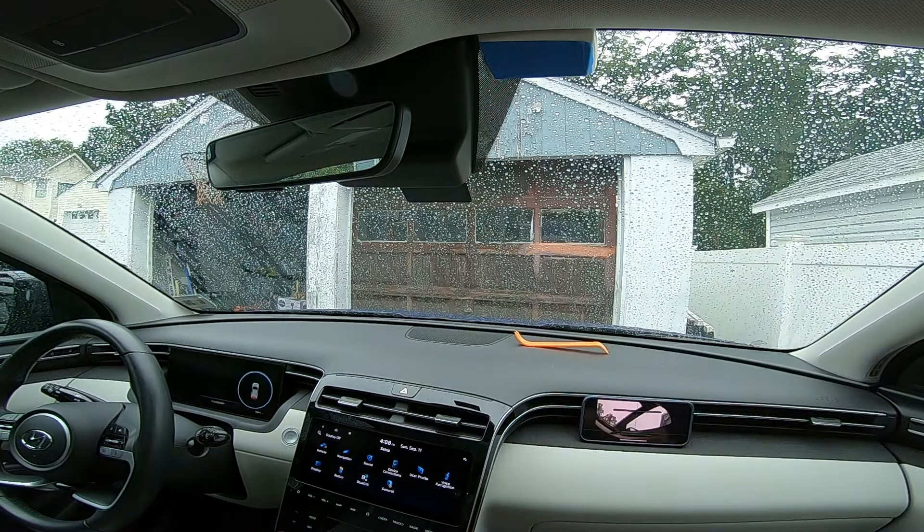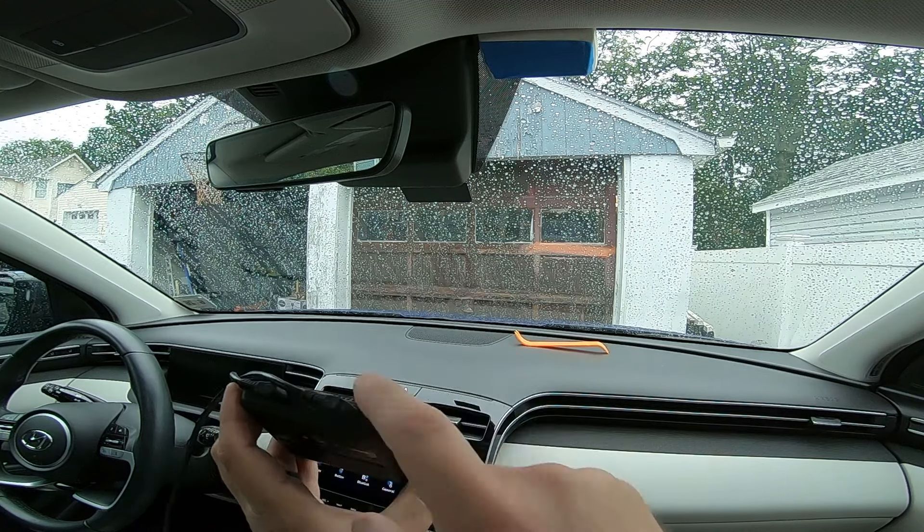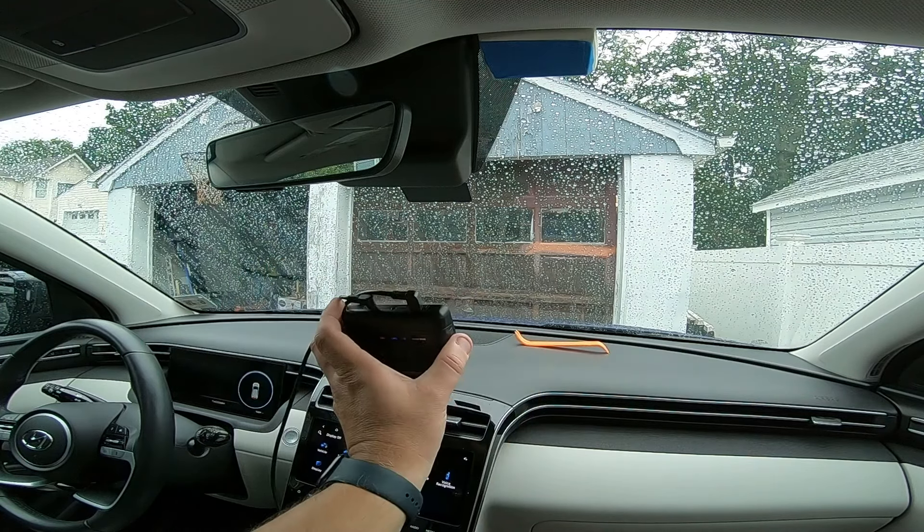When connecting the rear view camera, it detected it. We're using the straight connection here even though the manual says to use the right angle. What that does is it's not going to automatically right angle this up. But I want the windshield camera to be the absolute closest to the headliner. When we get to the rear, you're going to see a little loop, but I'd rather have the front be as neat as possible. I don't know why they didn't just right angle both ends — that would have been the smart thing, so it doesn't have to stick too far down in your dashboard.